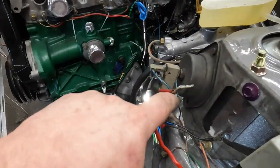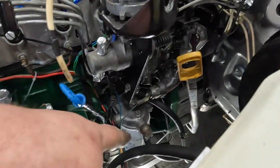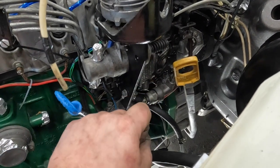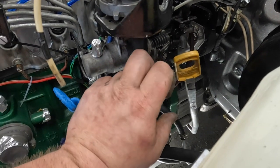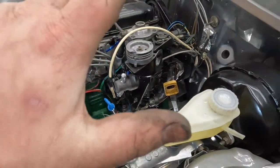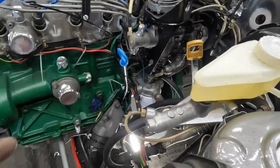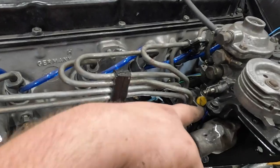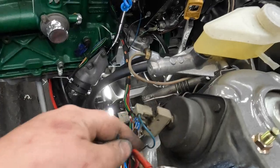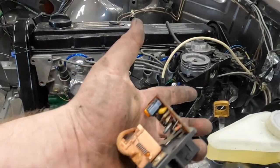One thing I also noticed is this broken wire here — this is a little ambient pressure switch. You have your altitude compensator solenoid on the injection pump right there. I'm not really sure what it does, but it is in the place where it would be manipulating timing, and also there's a tube going into it, so I'm guessing it changes some kind of timing or fuel mixture for high altitudes. But the Haynes manual is useless for the diesels, so we'll figure it out if it's an issue.